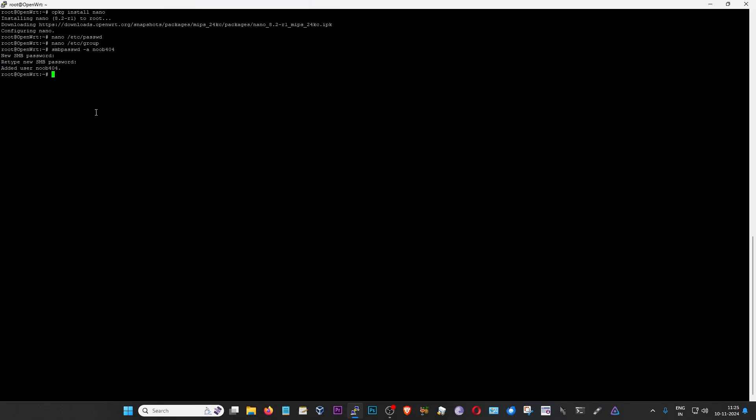Now we'll move on to the third step of the process: partitioning the USB drive. I had chosen the ext4 partition style. There are multiple options here — if you are doing this on a device which already has pretty good internal storage, I would recommend that you use a USB drive partitioned to ext4 or any other partition style you choose. If you want to create an ext4 partition on a newly formatted USB drive, it's pretty easy — you can do it on OpenWrt itself. The instructions for the same are given in the article linked in the description.